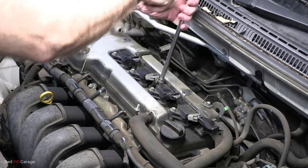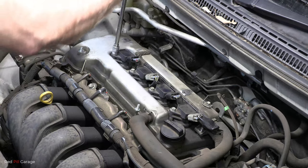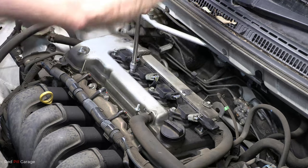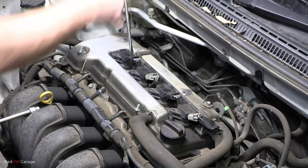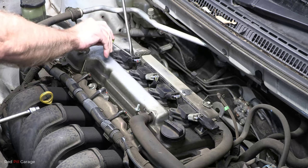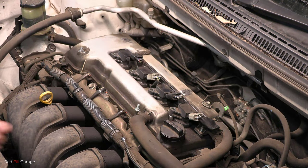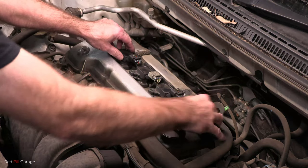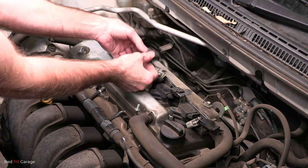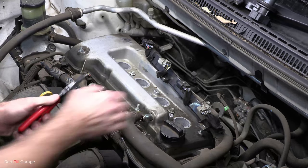When taking on a job like this, look at what's attached to the valve cover — things like your ignition coils, your coil harness, your engine breather hose or PCV valve hose. Those need to be removed first before you take the valve cover off. Here I'm just taking off the coil plugs. Be careful with them because on these particular Toyota Corollas, as they get older those coil plug connectors become very brittle and are easy to break. Next, remove the engine breather hose and PCV valve hose.